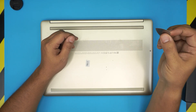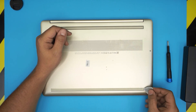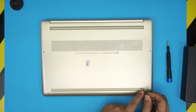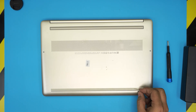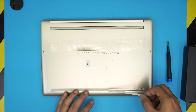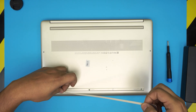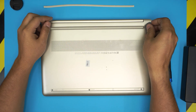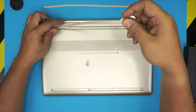With the guitar pick, remove the front and back rubber feet by sticking the pick under the covers and slowly peeling them off. They have a little adhesive. Once you lift one up, don't bend it over or you'll crack the rubber — just bring it up gently and push it away. Same thing on the back cover: lift it from the corner and pull it up.